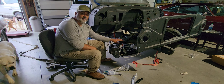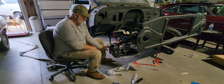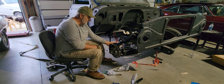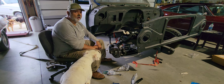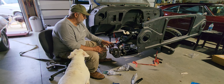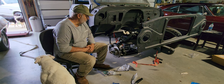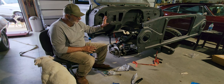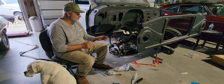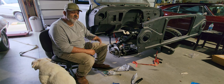Hardened bolts when you put in your ball joints. Pack your grease good in your bearings. Dust seal on. Caliper on. Now we're ready to go over to the other side and do the same thing. This is a drop spindle, so it's going to lower the truck a little bit. Once we get the other side done, we'll put on all our tie rod ends, center links, and all that good jazz, so our front end will be together.